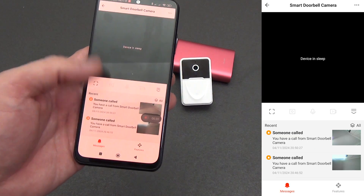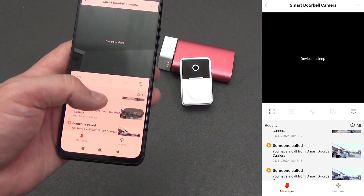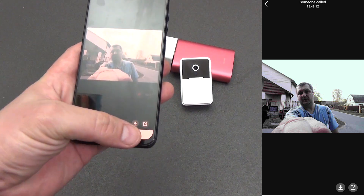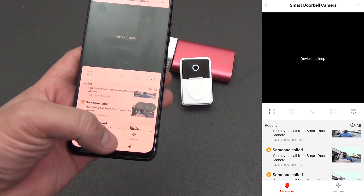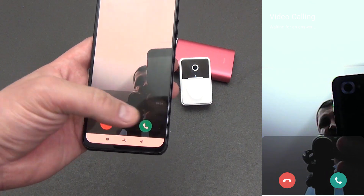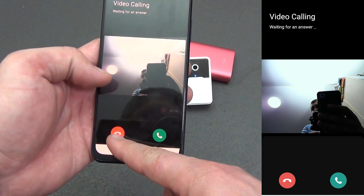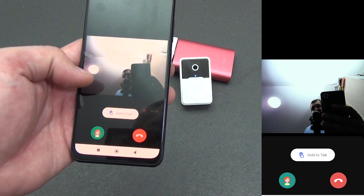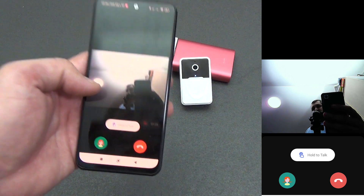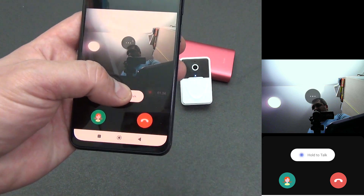You can view snapshots saved by the intercom of everyone who pressed the bell button — they are stored in the cloud and can be downloaded to your smartphone. This is very convenient when you cannot answer an incoming call or have no internet, so you can still see who came to visit. When guests arrive and press the call button, after about 5 to 10 seconds a video from the intercom camera appears on the smartphone screen with a sound alert. You can either reject or accept the incoming call. If you accept, you will not only see the camera feed but also hear the sound thanks to the built-in microphone, though the person at the door cannot hear you until you press and hold the talk button.